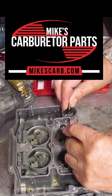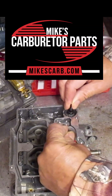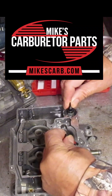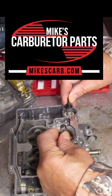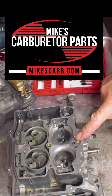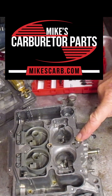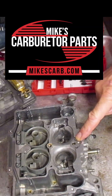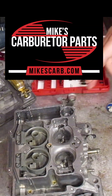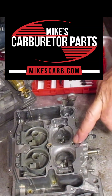Hold it down — you don't have to hold it down with too much pressure — then take the pump and pump it. You see nothing's coming out and you can feel a little more pressure. There you go — let the pressure up, it comes up. Hold it down, so you know the check ball is sealing. If fuel is coming out when you're holding the check ball down, it's not sealing. That's when you want to tap it very lightly with a hammer to form the check ball into the trough in the bottom of the main discharge.